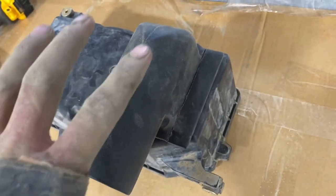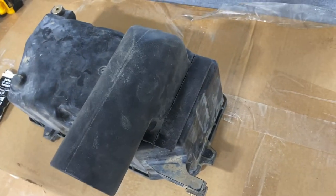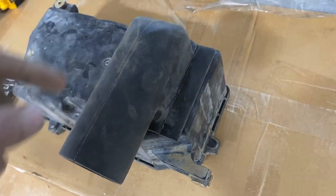When I do that, I'll go outside and on the inside of the fender I'm gonna drill a hole for this. Once I drill a hole for it, it should just feed right into it. Once I have the hole cut, it really is a plug and play with this thing, because the stencil's already lined up. I know where to cut the fender on the truck. It's just a flex hose that's gonna come from this and basically come out and then up to the snorkel. It's actually gonna be very simple to connect once this is made. This has been the biggest difficulty — figuring out exactly how to connect this without damaging any of the stock parts if I ever want to go back.